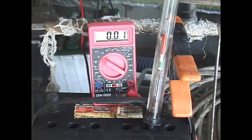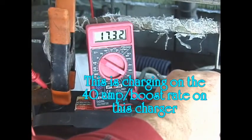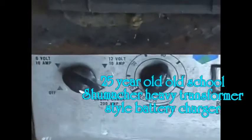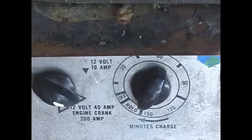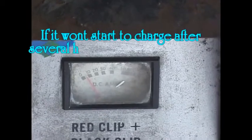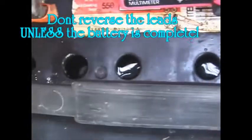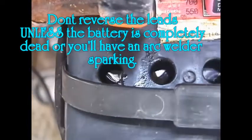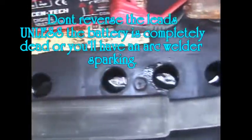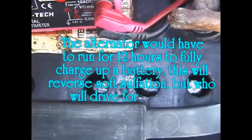Pop the caps off the top of the battery and examine the electrolyte levels. If the water is low, add distilled water to at least a quarter inch above the lead plates. The voltmeter is running at 17.32 volts — it's on the 40-amp boost rate, which is why it's so high — and it's only running at about 4 amps at this point. You can see it's starting to equalize and boil the electrolyte, and some cells are not doing anything while others are starting to function. A lot of times it'll take hours and hours before you can even get it going.